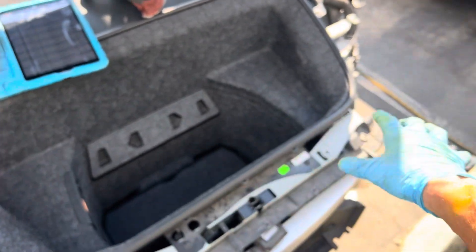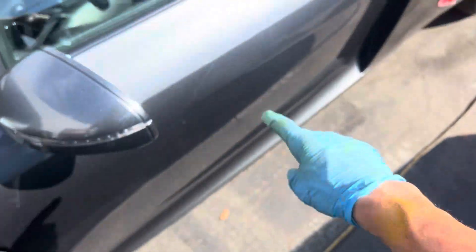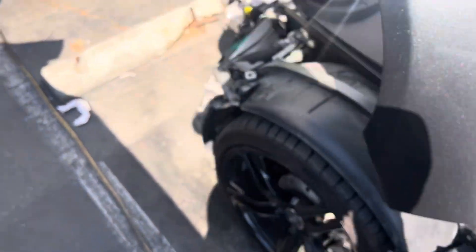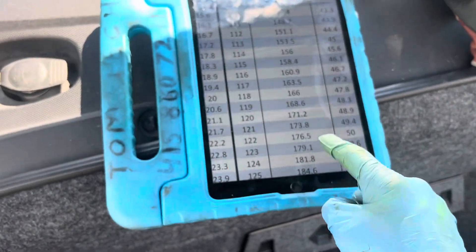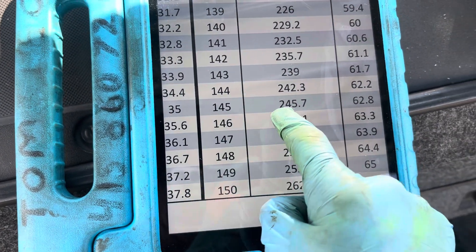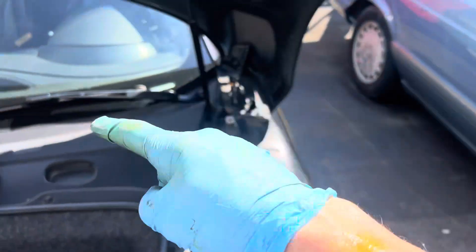Now for another mind-blow: getting the temperature clamp and going through all the metal tubing coming out the back. I burned my hand on this — it's coming out 145 degrees Fahrenheit at the pipe on the back side, not the compressor discharge. Let's go to 145 degrees Fahrenheit on the PT chart — 145 degrees, 245 psi.